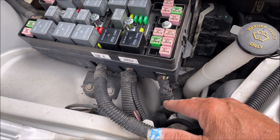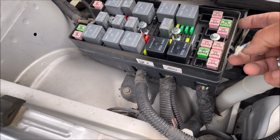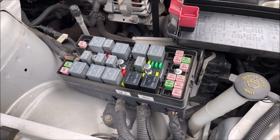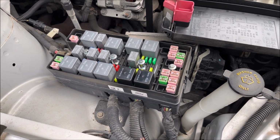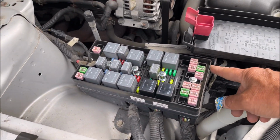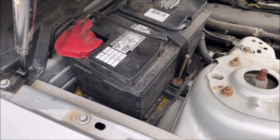I think you might take off this and verify what color wiring you've got there. But if the wiring that comes off of those two fuses is a different color than the ones that go into the amps back there, and if so, you could probably find where they go into the body and tap into those. But from all that I've read, you don't have the wiring at all for the Shaker 1000 amps. So F6 and F9 if you wanted to try to hook it up here, but I'll probably hook it up directly to the battery.